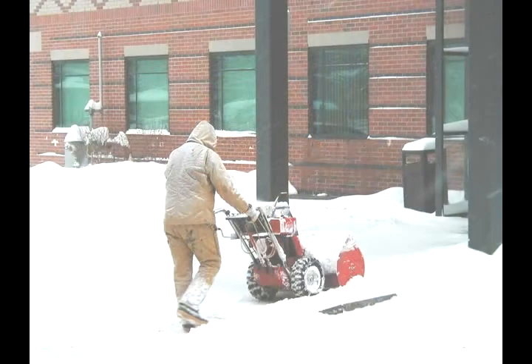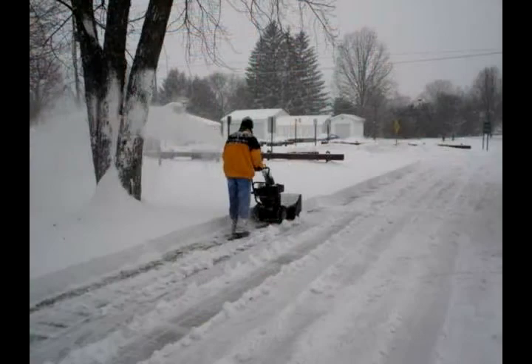Sandy, in order to avoid a hand injury while snowblowing, what should people do every winter? If your snowblower jams, turn it off, disengage the clutch, wait five seconds after shutting the machine off to allow the impeller blades to stop rotating. Always use a stick or broom handle to clear the impacted snow.